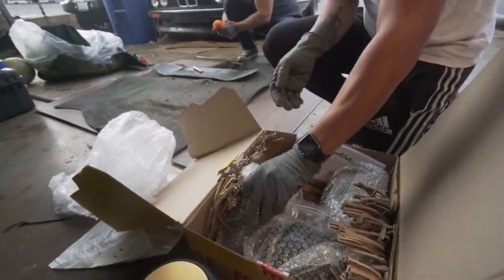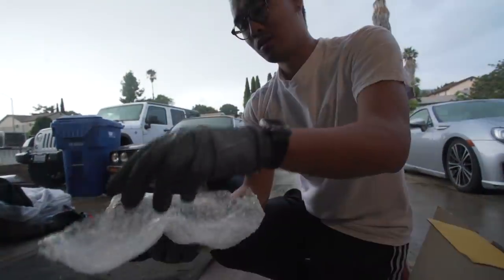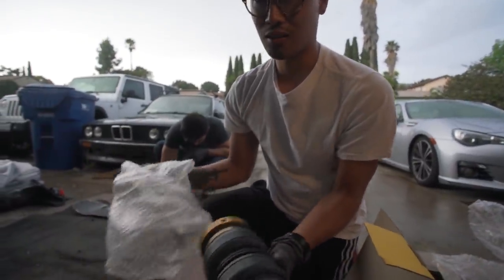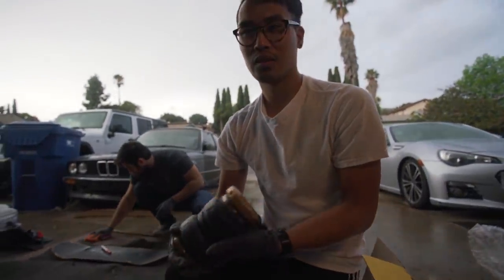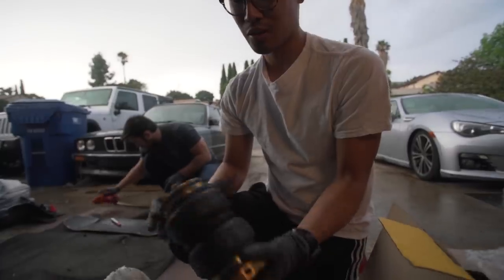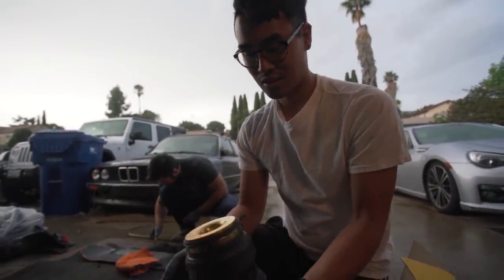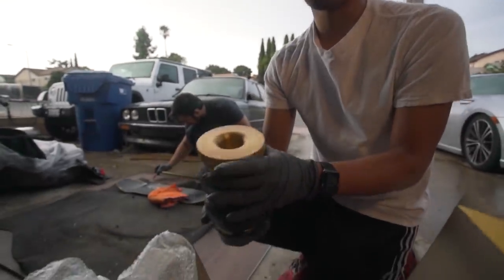And then for the rears, this is why they're kind of special ordered. For the rears, for bags on E30s, you kind of have to do a lot of modifications to, I guess it was the rear trailing arm, right? Yep. You gotta cut some stuff and route an air line through it. So basically it's really hard to put bags on the E30 in the rear.